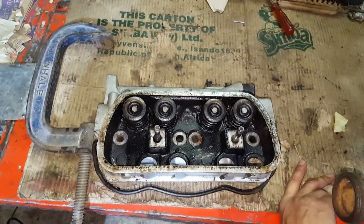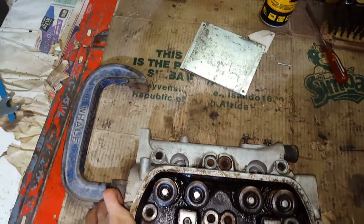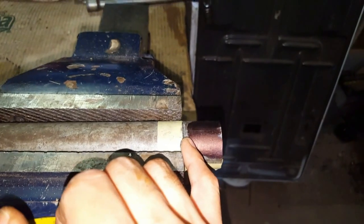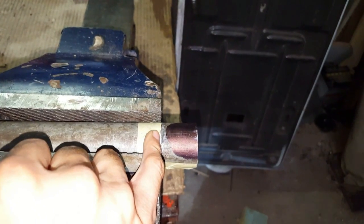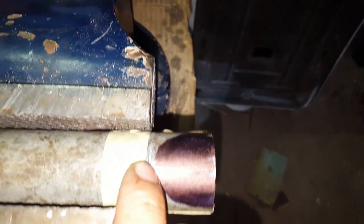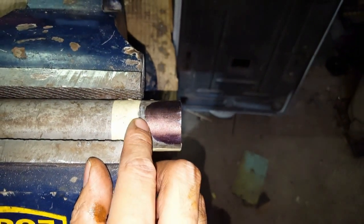So what we're going to do is improvise using some plate and two G-clamps — I've only got one here — and this piece of pipe which I have marked out to cut and to cut this little profile out. That'll allow us to get into the valve collets, compress this side, and this side will sit against the valve head cover so we can move the collets out. We're going to leave a little gap so that these don't split apart.